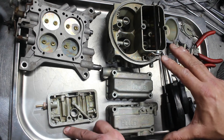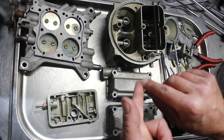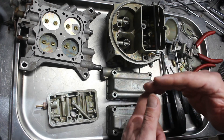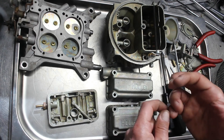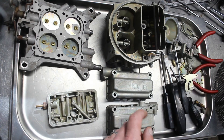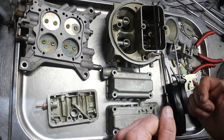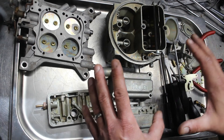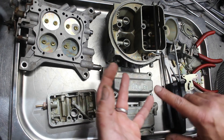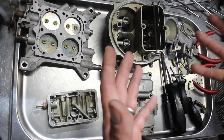The long and the short of it is: if someone comes to me with a carburetor and just says 'can you put a kit through it?' — no, it's not going to happen. I will do an overhaul or I will do a quick repair, but my cutoff line for repairs is very low. Unless it's something very simple like a perforated diaphragm or something painstakingly obvious, before long I'm saying no — we're taking this off, completely stripping it down, machining it flat, re-bushing the throttle shaft if it needs it, chemically cleaning it, doing everything we need to do to get it back to as good as, if not better than, a brand new carburetor.